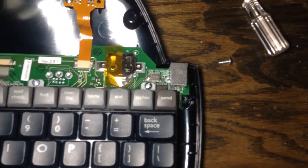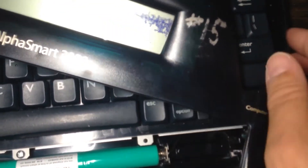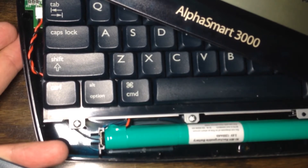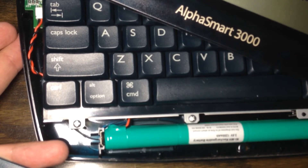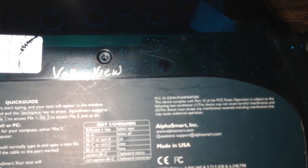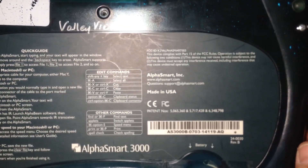So that's pretty much it for taking apart this AlphaSmart and putting a new battery in. If you have a rechargeable battery and want to remove it completely, unplug and unthread it, then you can put three AA batteries in instead. AA batteries last 500 to 700 hours, while a rechargeable lasts about 100 hours but can be recharged many times. I prefer AA batteries, but either option works. Once you're done, just put all the screws back in and you're all set.